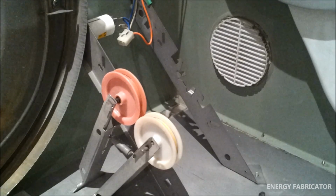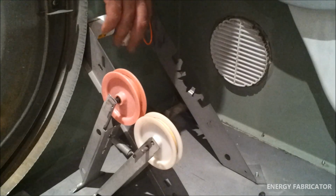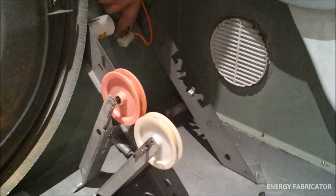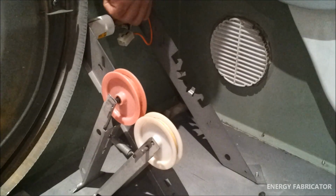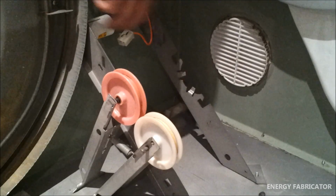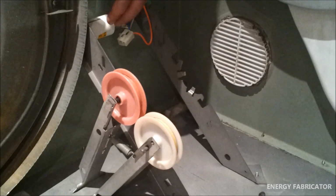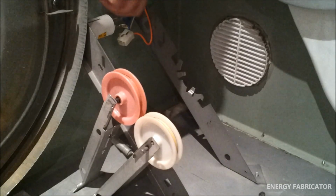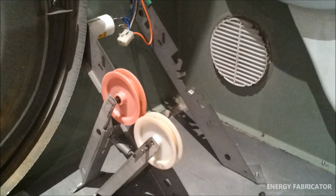But if you were to replace it, all you have to do is unscrew it or unclip it from wherever it's mounted inside your dryer and remove the 2 terminals just by pulling them off, usually, because they'll have these spade terminals on there, and put your new capacitor on, as long as it's rated to the same or higher voltage, and it's rated to the same capacitance as your existing capacitor, and just plug the terminals straight back on and job's done. Simple as that.